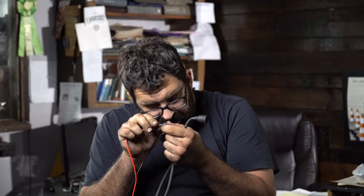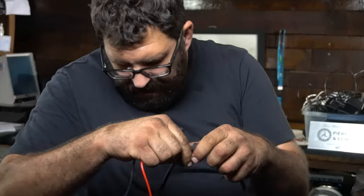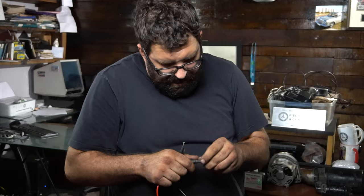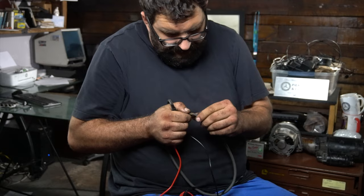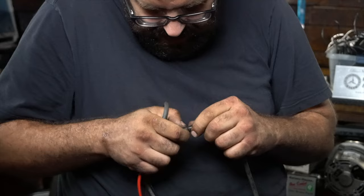Often times this resistor end is actually the bad part and will not read anything. Now let's try to figure out what might have happened to this wire. This is a Bosch wire, and this is why I've been hesitant about using Bosch wires — I like Beru wires a lot better because Beru wires tend to be a little more reliable. Even shoving my entire ohmmeter probe in here, I'm still not getting a readout. It's interesting — as I probe this in, we know that this wire is broken somewhere.